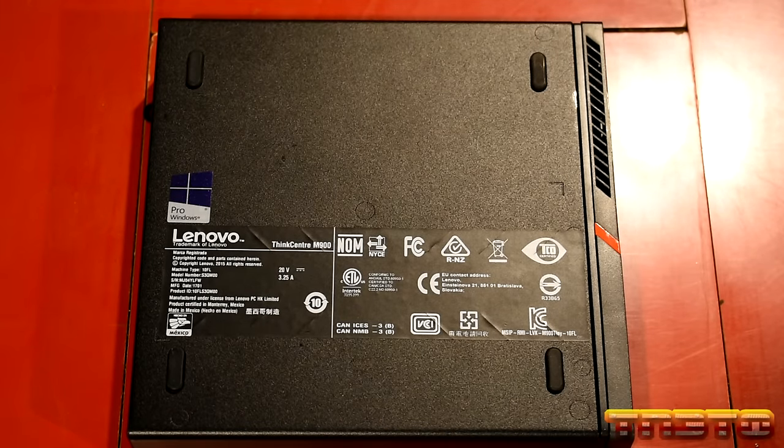So we've got devices, USB setup, USB support, legacy, virtual KBC. I'll just leave that default enumeration front. And this is where you can enable or disable USB ports, ATA, SATA controllers enabled, SATA drive 1 enabled, NVMe drives enabled, SATA AHCI already. Nice. Hard disk pre-delay is disabled. So those defaults already look pretty good.